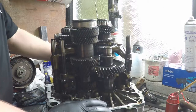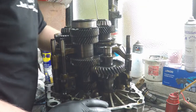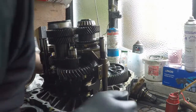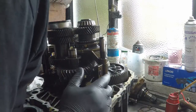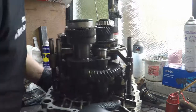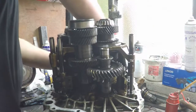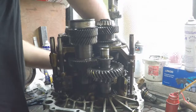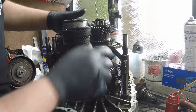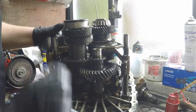I hate the smell of transmission fluid - it always has that very burnt smell to it. And this is the culprit, this is the one we're getting off. But let's give the gearbox a general visual check. I've got a bit of swarf on the magnet, but the magnet is designed to collect the swarf. Even a brand new gearbox is designed to have a little bit of wear into it - hence putting the magnet in. Really checking to make sure all the teeth are in good condition. Quite hard to rotate because all the weight on the synchros and the selector rubs, so all the gears are trying to engage just a fraction.